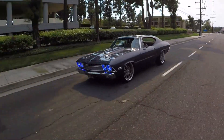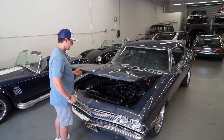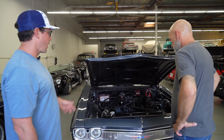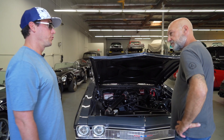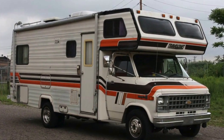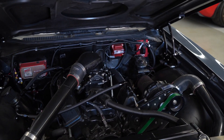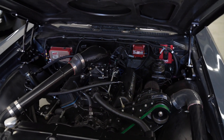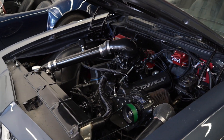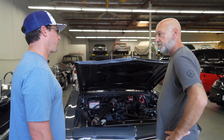One of the coolest things I did with this car is I actually built this motor back in 2004. I took a machine shop class at Saddleback Junior College. I got this block out of an '81 RV — four-bolt main, rusted together. I probably hot-tanked it 20 times to clean it, and then I did all the machine work. I balanced it, I blueprinted it, and it's a 383 stroker. Compression was like 9.45 to one, so it probably made a little over 400 horsepower.